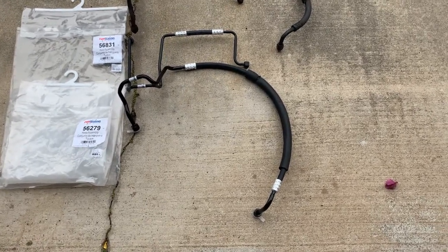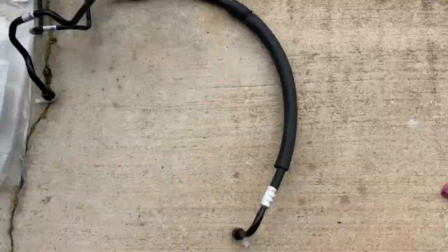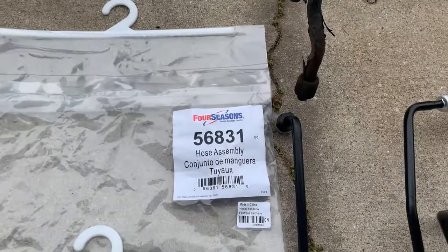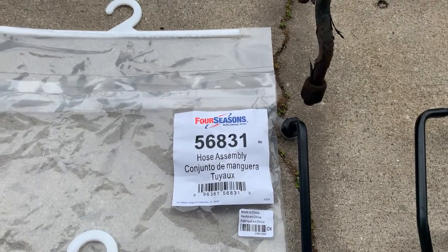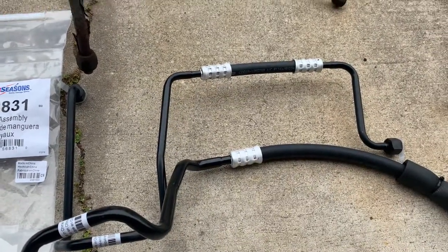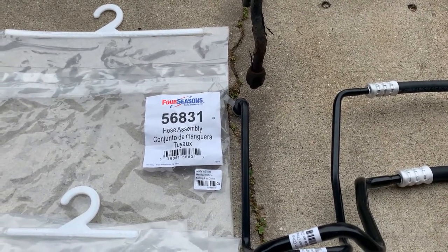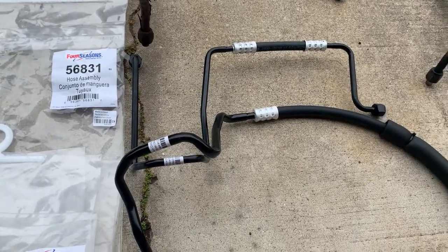Okay, these are the new hoses I got and comparing with the old one, it looks the same. I hope the fitting is also the same. An interesting thing is this discharge hose is for a 93 Cherokee. But this liquid hose, according to the manufacturer website, fits from 94 through 96 Jeep Cherokee. But it looks like this is gonna fit the 93 Jeep Cherokee also, and that's probably because of the upgrade to the R134 system. So the original 93 Jeep Cherokee uses R12, so that might be the difference. But this Four Seasons tube is certified for R134, so it should be safe to use it.